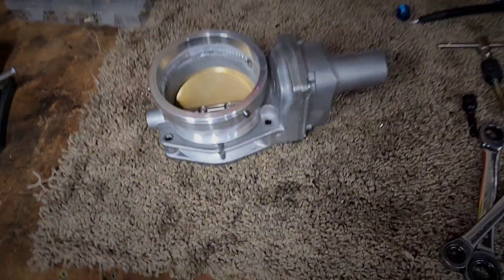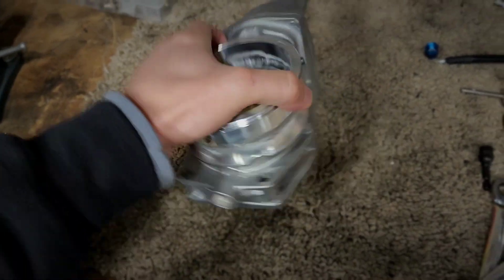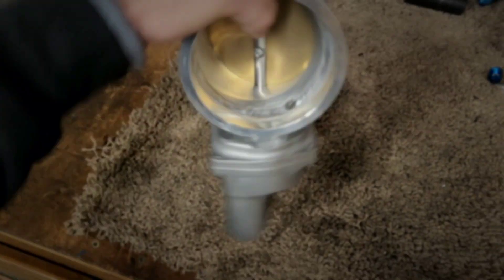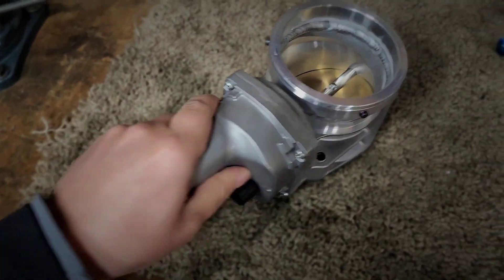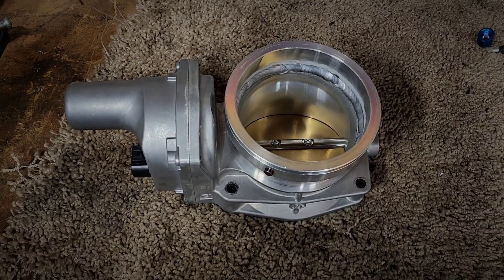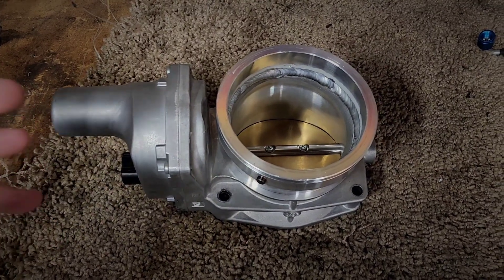So you're going to take a throttle curve, and I'll show you guys what I mean. If we go here, we are looking at an LS3 drive-by-wire throttle body. A lot of people would say it looks like it's open — this is by design. This level of openness on this motor is so that in the scenario where this motor stalls out, there will be enough airflow to idle this drive-by-wire. These on average will have a roughly 30% opening to handle the idle control region.